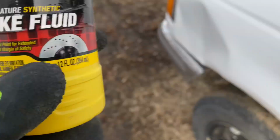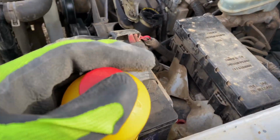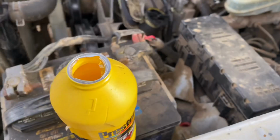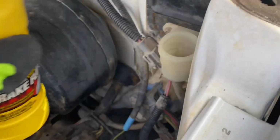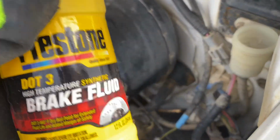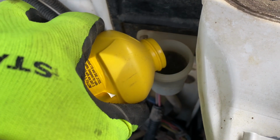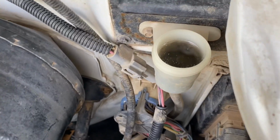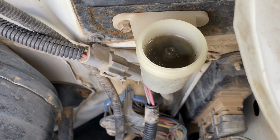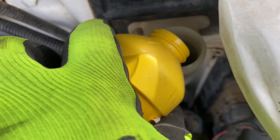And this is a video when I just got the truck, when I used a fresh DOT 3 brake and clutch fluid. And like I said, the system worked, but just for about a day, and it failed. All the fluid drained from the reservoir. I'm thinking it leaked at the oil seal of the clutch slave cylinder. You can see initially there was quite a bit of dirt inside the reservoir, and a lot of air, purging the air there slowly by gravity.